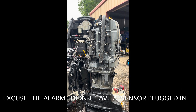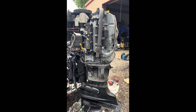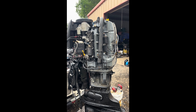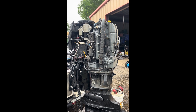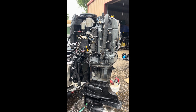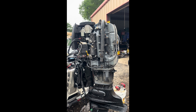Now we're going to see what the flow rate is with the engine running on the muffs. We know there's going to be a period where it's the same before the thermostat opens, but I'm doing this for two things: one, how long does it take for the thermostat to open, and two, what is the flow rate of water going through the engine with the engine running on muffs and the thermostat open. We're starting it up at the one-minute mark on my video to keep track. The engine is on the muffs with a pretty good seal — everything's blowing off due to back pressure — but we're going to start it up.